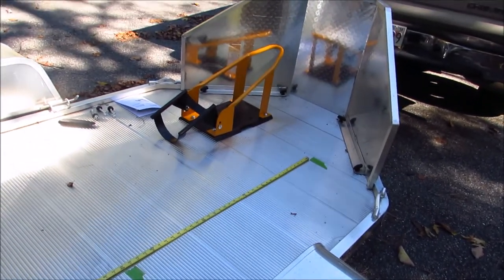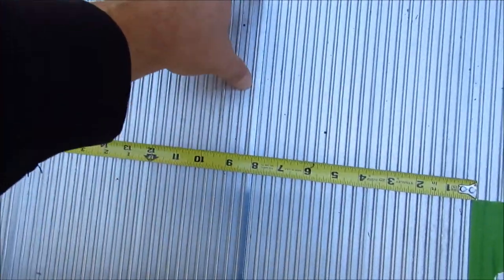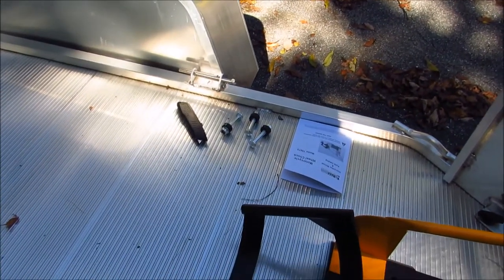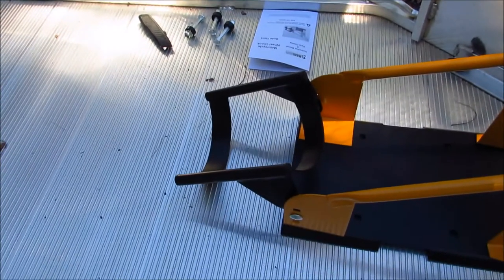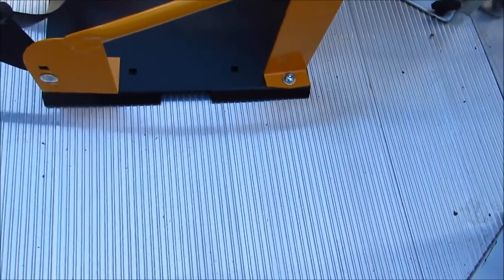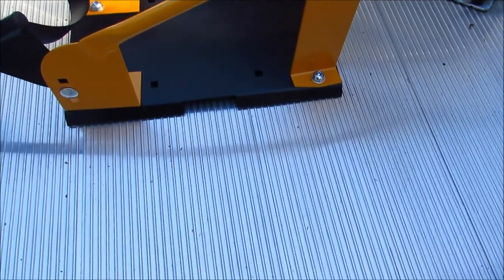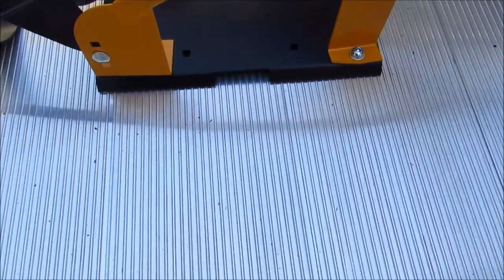We'll line up the chock. I don't know if you can see it on this video, but on mine there are metal ribs. Every place you see a seam, there's a metal rib under there. So when we drill, we want to make sure we're inside those so we don't hit the ribs. We're going to use those bolts over there. They have a metal washer that goes up under the trailer through the floor. And then those black spacers go under this, since we're not mounting it in a truck bed. You see how it's kind of raised so it fits over the ribs of a truck bed. We're not doing that, so we'll put the washers under it to fill up that empty space so it doesn't bend in.